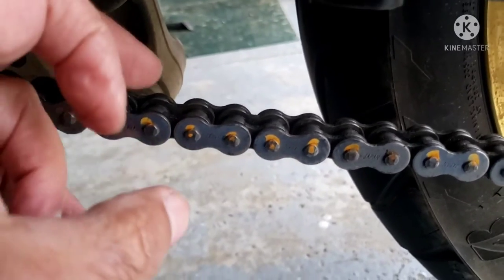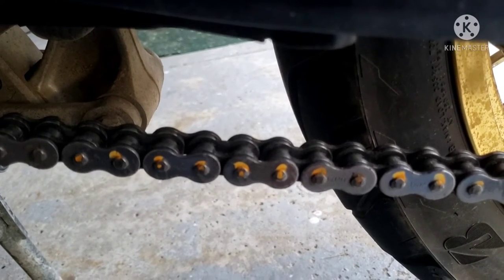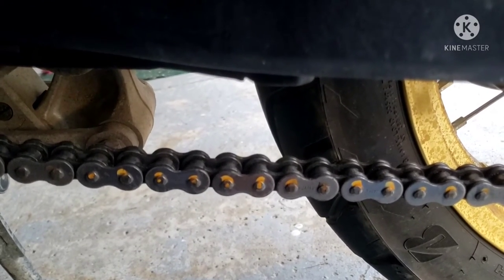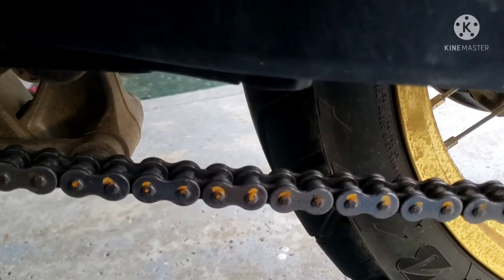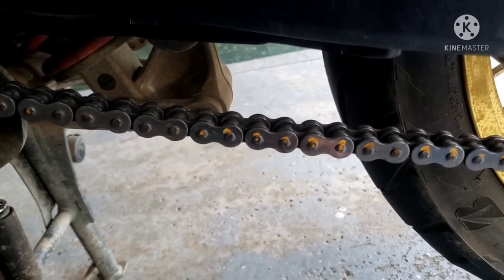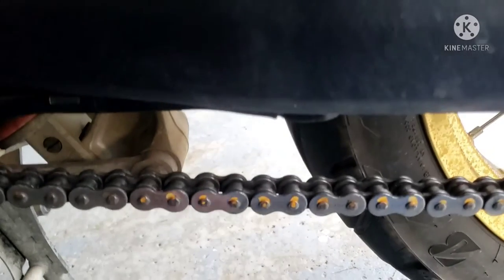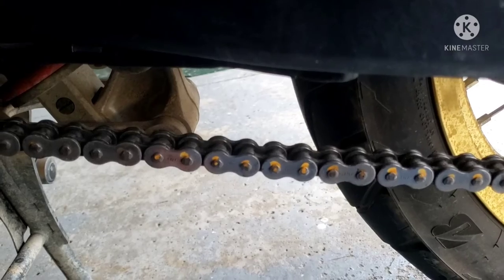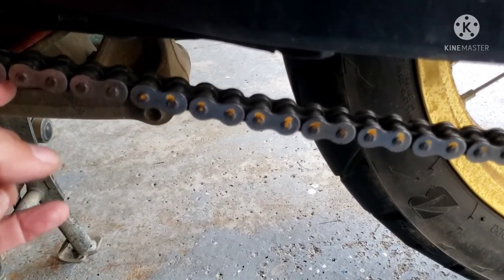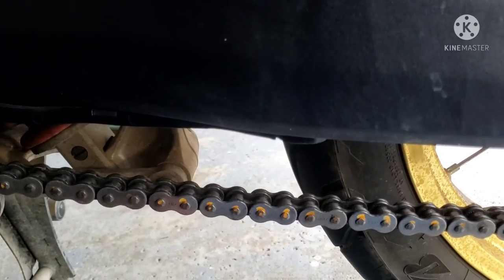The O-rings keep the grease inside the roller. As the chain starts going around the bike it's making heat and friction, and that grease over time will wear out — then your chain will start stretching. In the old days, one of the first chains I had on my 1980 Harley, almost every ride I had to adjust the chain. This chain here is the one I got stock from the bike — it's a 2019 Africa Twin with 6,000 miles on it and I've adjusted it once. A loose chain is better than a tight chain, because as the shocks go up and down a tight chain stretches. My wife's Honda Rebel, I think we got 30,000 miles out of her chain and only adjusted it a handful of times.